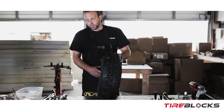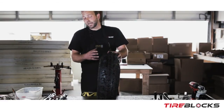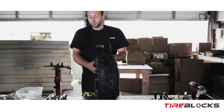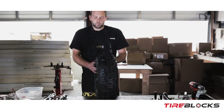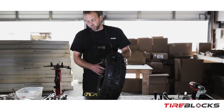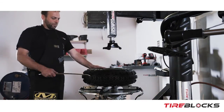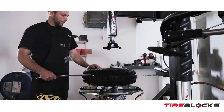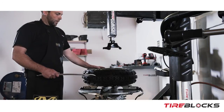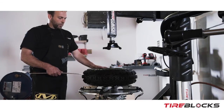With other tire sizes, be aware that the larger UTV and ATV stuff gets a little more challenging. Especially if the foam is a denser foam like we use in UTVs. With a bead lock, at that point you'd just bolt the ring on and you'd be done. So we've got the blocks installed — I'm going to mount the second half on this tire machine. The method is pretty much the same no matter what size tire, though obviously bigger stuff can be a bit more challenging.